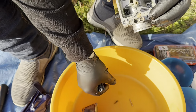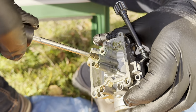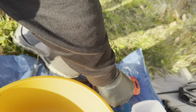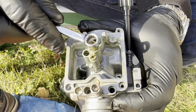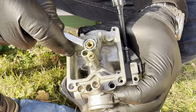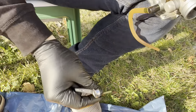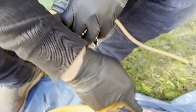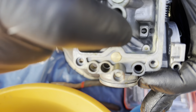I'm setting that aside. Same thing with these others. This one goes in the second little thing over here - use a wrench size 8 for that. I'll put it in the same little bucket as the nozzle that belongs to it. I'm going to put the little bowls in the same positions as these holes, just to remember where everything goes.